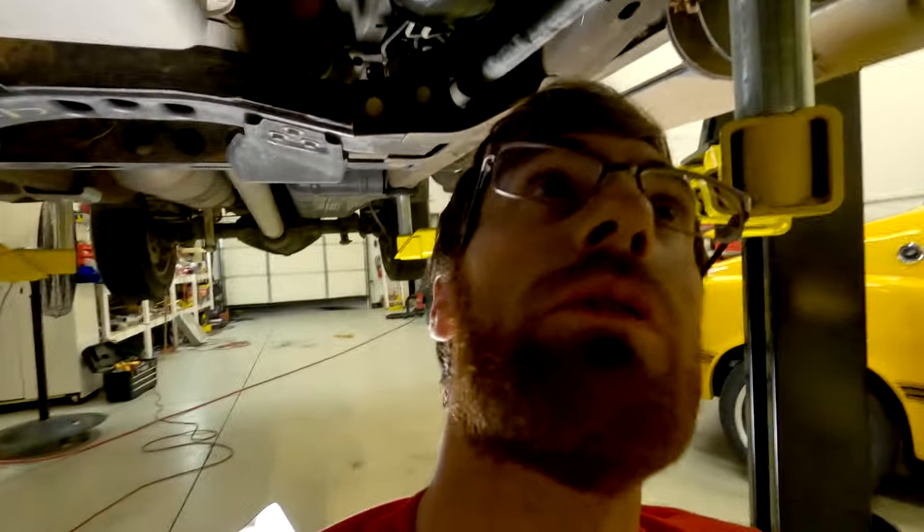It's all in there. We put our mileage and date on the filters so we know when to change them next — as you can see, that's all in there. There's a little bit of a leak behind it, but I haven't put any oil in it yet so that might just be from what I had on it originally. Got the drain pan on, putting the skid plate back on — I never actually needed to remove that. We'll go ahead and lower the truck down, top off the oil, check the level, and we should be done.